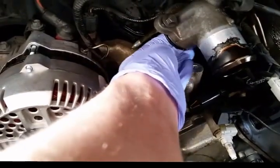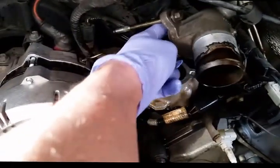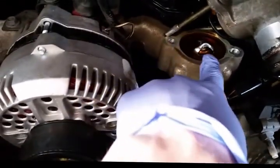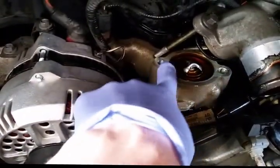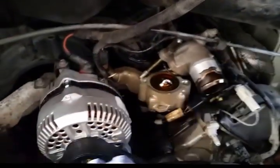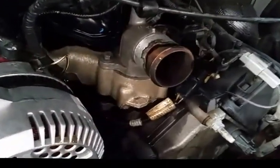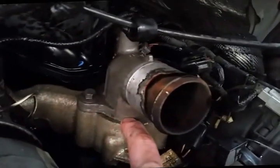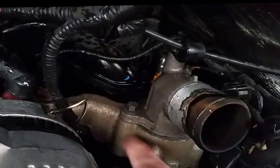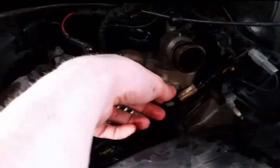Now, remember that gasket sealer we got earlier? We'll go ahead and replace that seal with the new seal we got. We're going to want to put that gasket sealer right around here — that's going to create a good liquid seal because this needs to be waterproof going in and out. That will conclude the thermostat repair. We'll put everything back together step-by-step. We've got it screwed down there — notice how it's flush. You just drop the gasket in there and tighten it all down. Now we're going to throw back on the hose and squeeze it a little bit to see if that bit of pressure shows a leak; otherwise we need to tighten it down more.